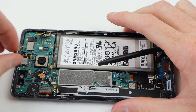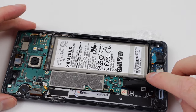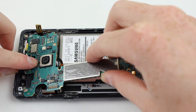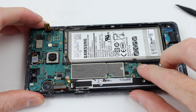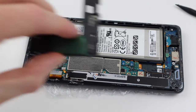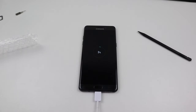Removing the motherboard is quite simple — it's held in with two screws and a series of flex cables and connections. Once undone, I remove the SIM card tray and lift the motherboard out. The earpiece cable hidden underneath doesn't appear damaged, so hopefully it still works. I'll reinstall the motherboard making sure everything is connected and seated correctly. With the phone together enough to test, plugging back in the USB-C cable we're still getting the same temperature warning.